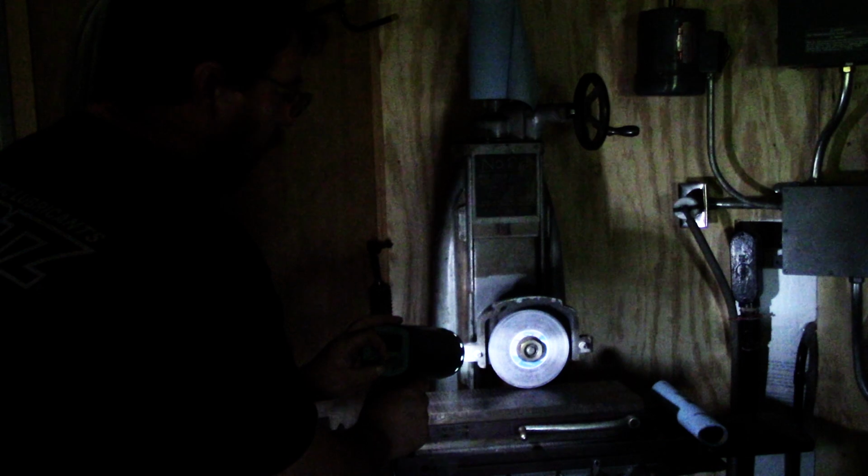So we can stop the motion, we can rotate it to wherever we want. So this will allow us to explore exactly what's going on with the valves once we spin it up. We can go right to the critical points, and we can see if the rocker is losing contact with the valve. And of course, we can push it beyond its rated horsepower, beyond its rated RPM, and see where it starts to have problems. So anyways, really useful tool.